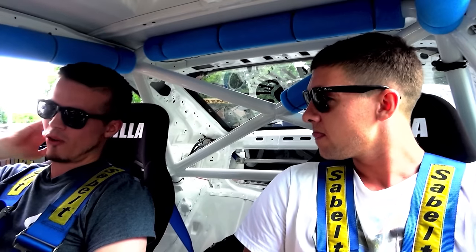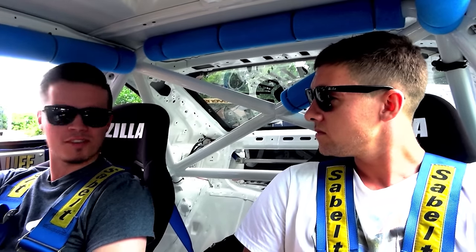You said it was mapped by Martin, MB Automotive. And what turbo? It's got a GTX2867R. Okay. That's why it's so responsive. Because there's no lag in this car. Well, it sort of boosts at what, 3.5? About 3.5. Yeah, which is pretty responsive. 1.4 bar boost. Then I've got a custom bottom-up manifold.